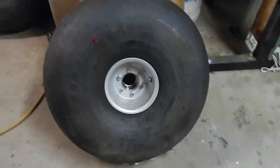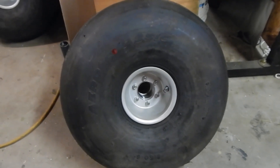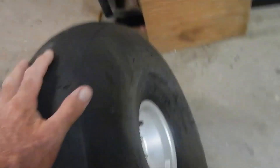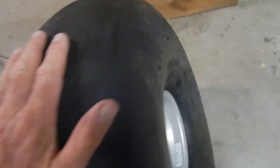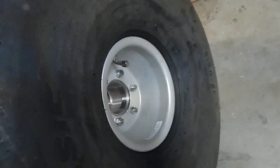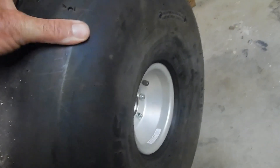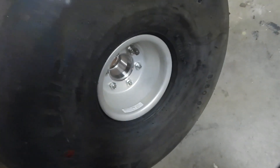I should have filmed this seating process. I brought the wheel over to my compressor with a bigger hose. The tires were unseated and kind of loose. I pushed down on the top of the tire as I was putting air in, and I could feel when the air caught and the tire expanded. At about 15 pounds of pressure, both sides popped and seated. I've got 23 pounds in there right now — a little heavy, but I want to make sure it's not going to lose any air pressure and that everything's sealed correctly.